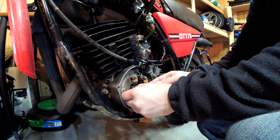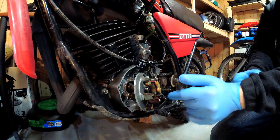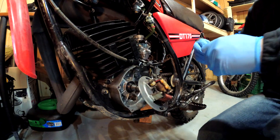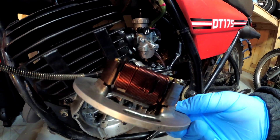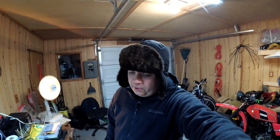Applying glue — we'll end up putting quite a bit on there but hopefully it will be okay. I'm going to let that cure a bit and then measure the seal. Once that's good, I'm going to get the old Woodruff Key out that seized up in there. Probably should have gotten the Woodruff Key before I replaced the seal, but I didn't know there was one in there — it was smoothed over and blended in with the shaft. Bamboozled me.